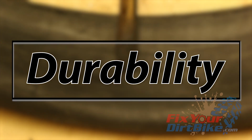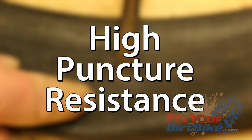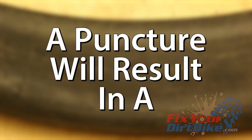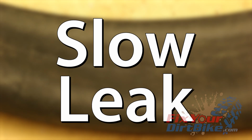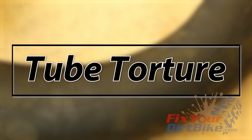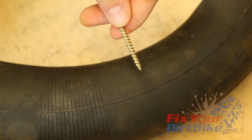Because of the natural characteristics mentioned earlier, natural rubber has a much higher elastic limit. This translates to a high puncture resistance because the tube can absorb the puncture. This also means that a puncture will result in a slow leak and not a catastrophic failure because the rubber will not tear. To demonstrate how the elastic limit affects flexibility and durability, I decided to torture an old tube.